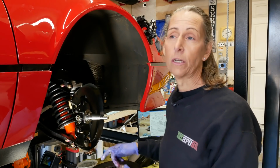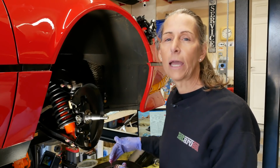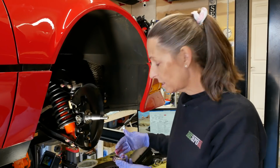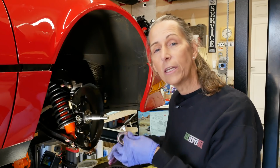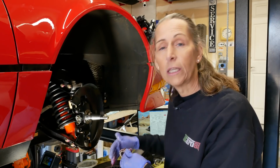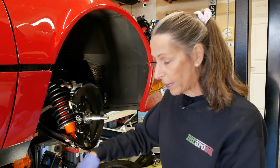It's a great question. I think some of the downsides of packing it completely with grease is that the bearing can get a little bit hot and it's difficult for it to dissipate any heat. But if you don't have enough grease in there, when these bearings start running and get a little bit warm, that grease gets a little thin and starts to flow. It's nice to have a reservoir, a little bit of extra grease in there that it can pick up on. So I'm going to kind of split the difference. I'm going to pack it a bit, but not crazy pack it.